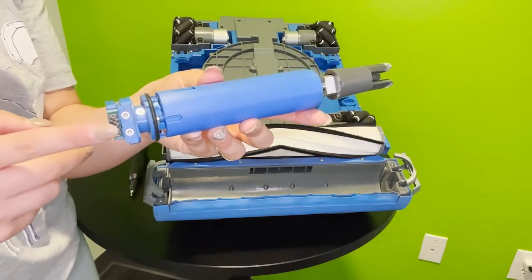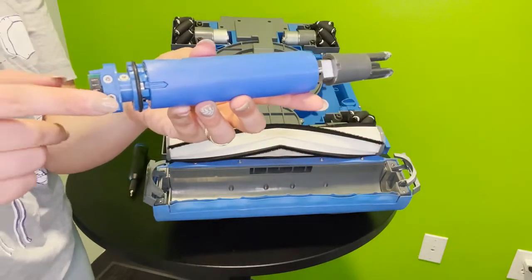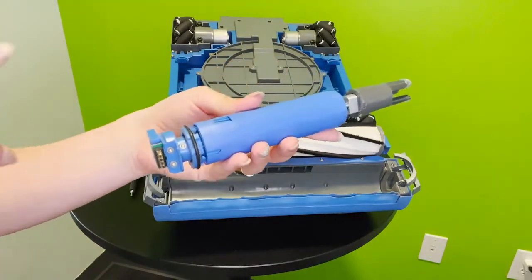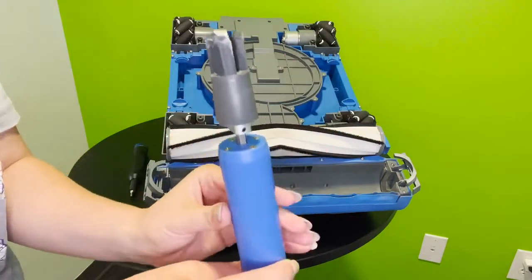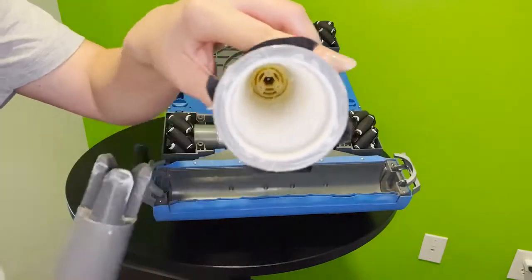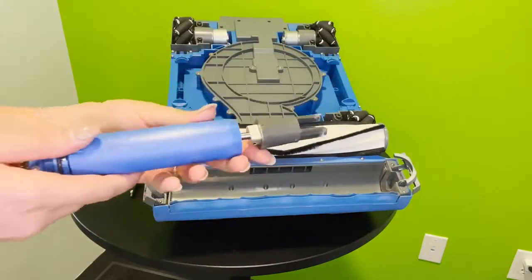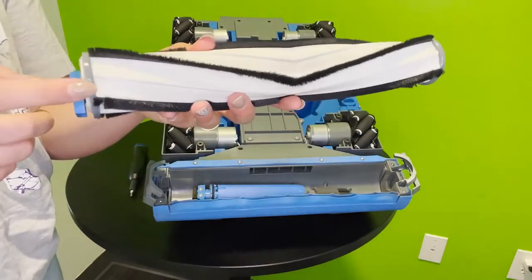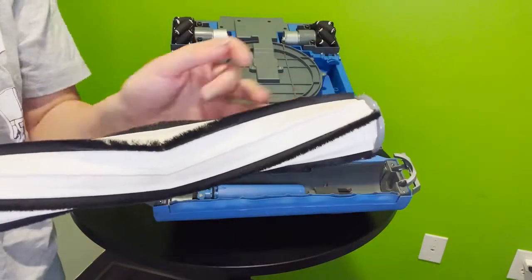There is also a little chip here that is a data chip that plugs into the robot and helps us receive any roller frequencies and error messages back at headquarters, so we can help you diagnose and troubleshoot your robot with greater efficiency. I would recommend being very gentle with this part of the robot, and again, not jamming it in or doing anything too violent with it as you place it back in. Those 3 forks on the top are simply what holds the roller to the motor, as you can see inside here, and it might need a bit of cajoling to get back into place in the roller, but we'll cover that when we're all finished.